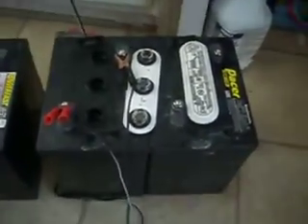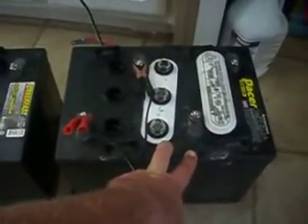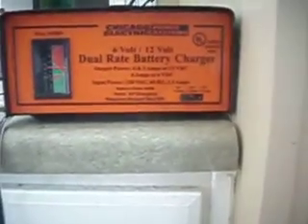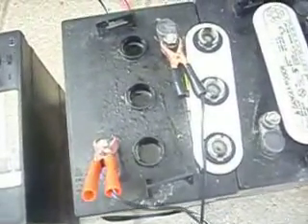Right now, because these two batteries were abused — they were taken down below 50% charge — I'm having to cycle them with this charger. I had them hooked up in series and charged them first at 6 amps 12-volt, then at 2 amps 12-volt. Then I'm splitting them and putting 6 amps at 6-volt into each battery. You can see the bubbles in there coming out of that one. I'll track them with the hydrometer and the meter later to see if I can get them up close to about 7.2 volts.